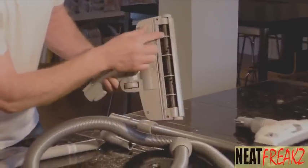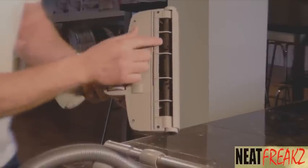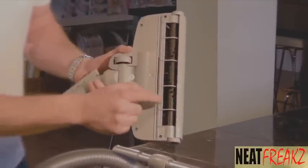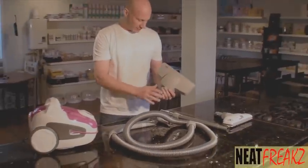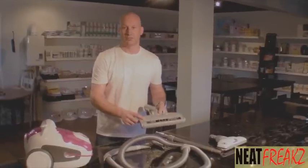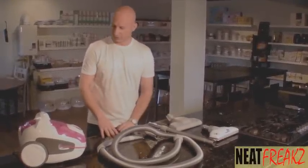In here, it has a little trench. If you're a person who likes to sew or you have long hair, you'll notice that the hair will sometimes get stuck. You can just move a knife along that and cut the hair straight out without having to open the entire vacuum cleaner to service. Another nice thing about this turbo brush is it's driven with a geared belt — no need to change belts continuously every year. That one requires very little service.